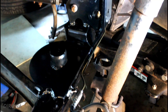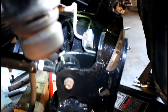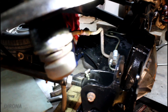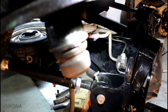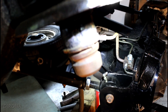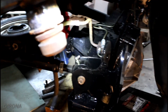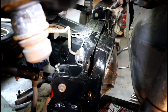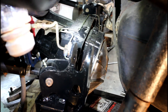So we go from the rubber hose up to a hard line, and then the hard line runs up behind the track bar bracket right here. Obviously we don't have the track bar installed yet. It connects into the factory TJ T-fitting for the rear brake lines — I reused that, and it looks like there's going to be enough clearance when the axle's at full compression, so that's not going to hit the floor. If we didn't have that clearance, I would have just used a regular T-fitting from the auto parts store and run a custom rubber hose from that up to the frame. Going from there to the other side, we've got another hard line. I bought pre-flared lines, which only come in certain length segments, which is why that little funny-looking loop is in there — because I had to take up some slack.